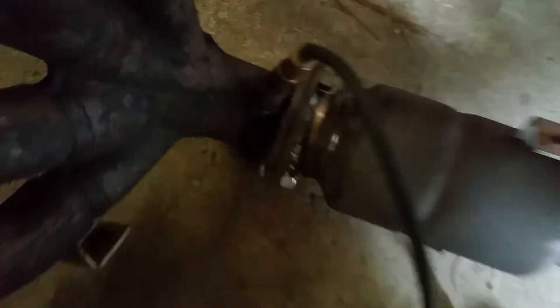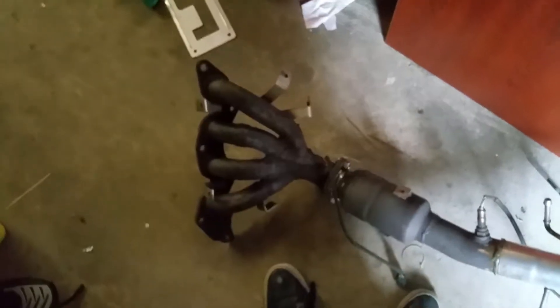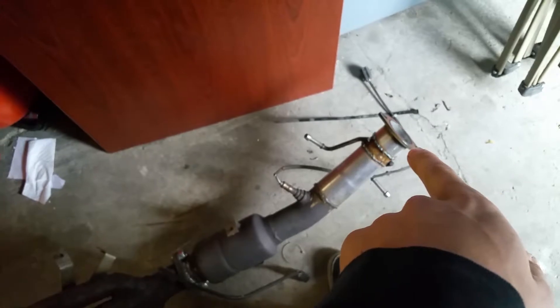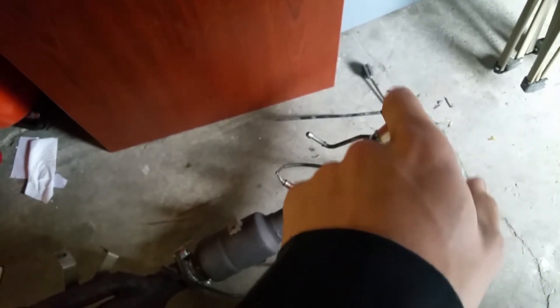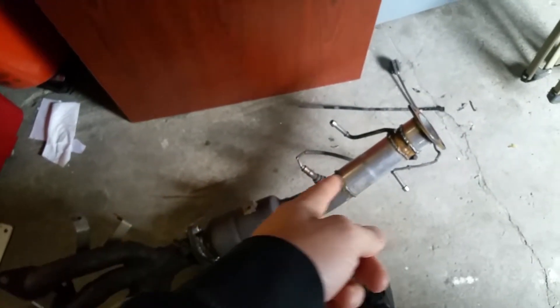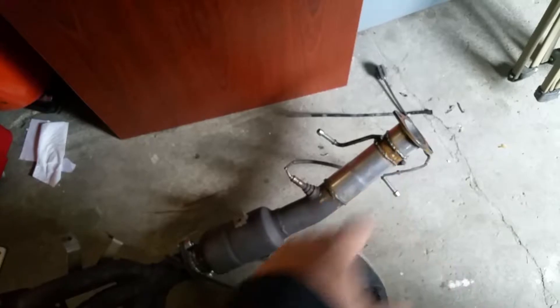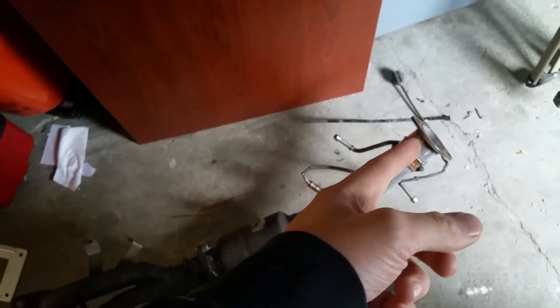I had all my flanges welded on real nice, and I'm gonna go ahead today and drop this into the car and then line this up from underneath as well. I don't have a flange welded up to the other end of the exhaust yet. I'm gonna actually drive the car with just this setup here, so it's gonna be pretty loud. But it was loud before - this section of my flex pipe was broken off anyways. So now I'll put this all together, drive it back to the shop, or I might just weld it here with the flux core.